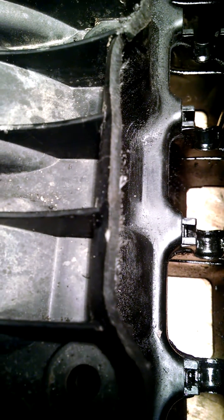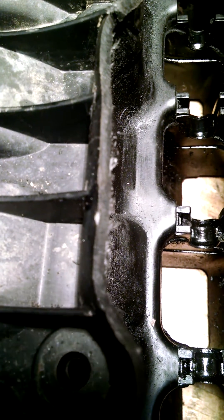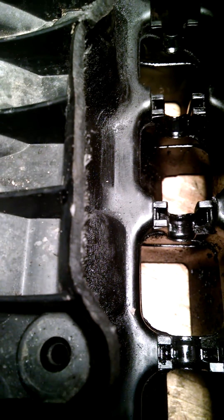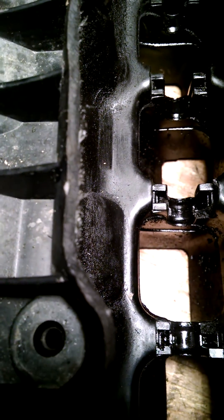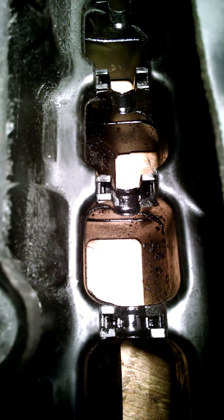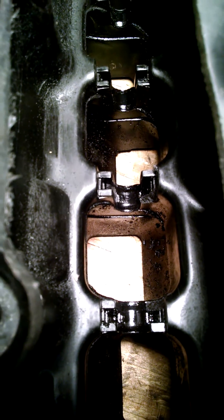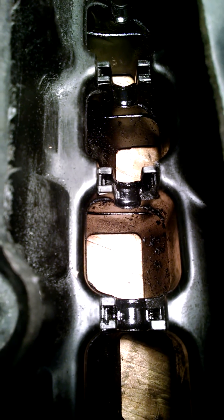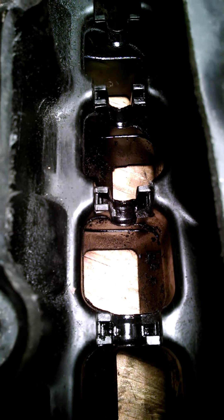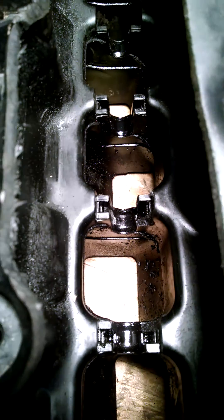So I guess the blisters rubbing against the soft rubber journal would cause some resistance — and that's what I found. That's why I don't believe lubricating this thing is going to fix anything. What you need to do is, if it's out of tolerance and it's tripping a code — P1004 — get a new manifold. That's really all you can do. About $350 used and $1,700 plus new.